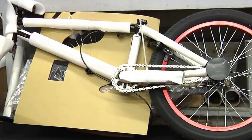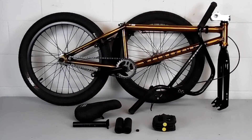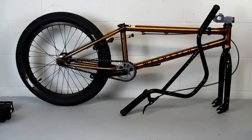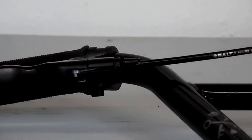When you pull your complete out of the box, it'll look something like this — this isn't the bike we're putting together. First thing you do is strip away all the cardboard and take all the pieces and separate them. Sometimes the brakes are connected to the handlebars, sometimes they're not, but the first thing we're going to do is disconnect them anyway. That way it's just out of our way and we don't kink the cable when we're assembling the bike.